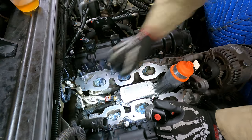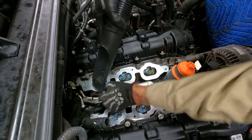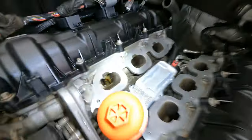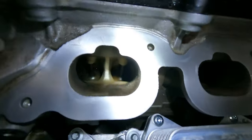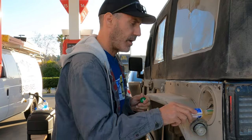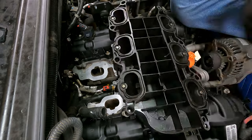With fresh parts in hand, I installed new gaskets on the Dorman housing — those go in dry, but the O-ring needs a little oil to prevent damage during deployment. Carefully set that thing in place and torque the bolts down to 106 inch-pounds in a cross pattern. Connect the sensor wires and make sure your coolant hose is secured. I'll grab the shop vac again to make sure no extra junk escapes down the intake ports — check out how good it looks down in there!